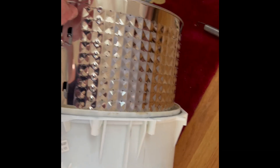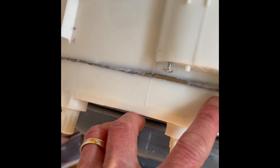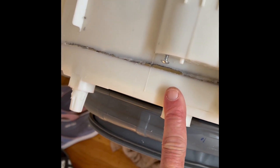The new spin basket is now in the tub, attached to the back, and spins great — confirming the rear bearing is in excellent shape. We just need to address the groove burned into the front part of the tub by applying plastic sheathing with epoxy on the outside and filling the groove on the inside with epoxy, then let it dry and put it back together.